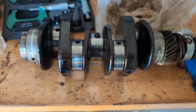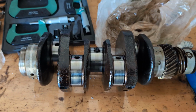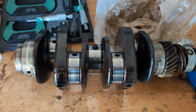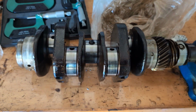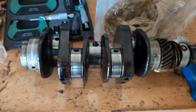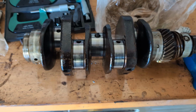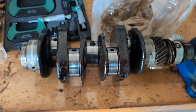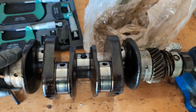You just don't know. If you have an engine that is a Volkswagen factory rebuild and that has a yellow tag on the top, that is most likely been align bored. They pretty much all bore them, and there's a really boring story about that. I'm not going to bore you with it, but the long and short of it is they are pretty much all align bored.